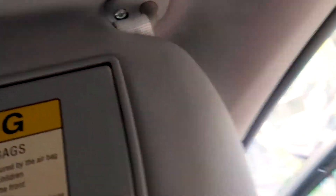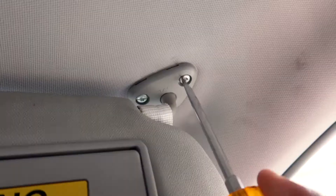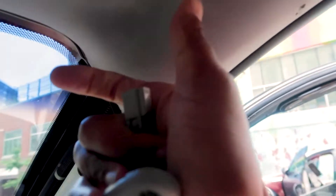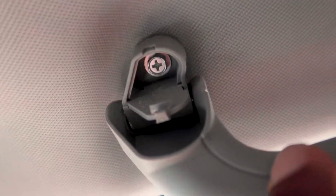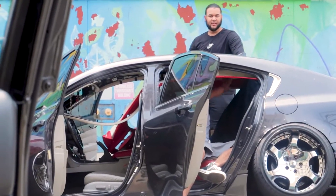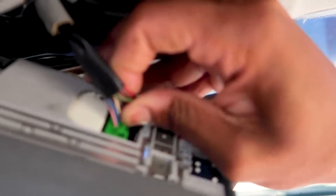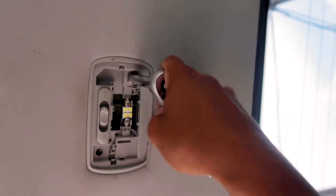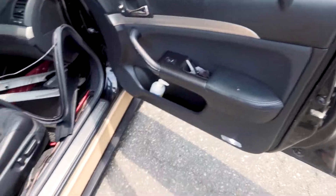Your one didn't have a bolt? Nah, I gotta push a little clip, push it in and then turn the wires, and then it comes off. Alright so you take this cover off and there's two screws here — we're gonna take that out. They look like Torx, but you could use a Phillips head — turn it, comes right off. Once you got it out you're gonna see this — this is for the LED, just take it out, comes right off. Next we got two 8mm bolts in there. He already got his whole front half out. I'm still here. I'm gonna remove these in order to get this from being tucked — remove that. I think this is ready to come down.